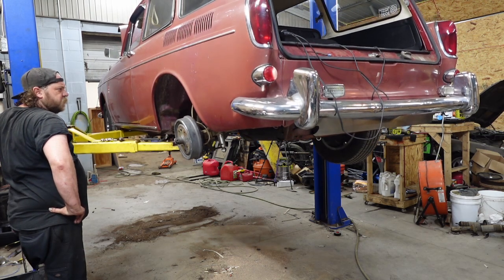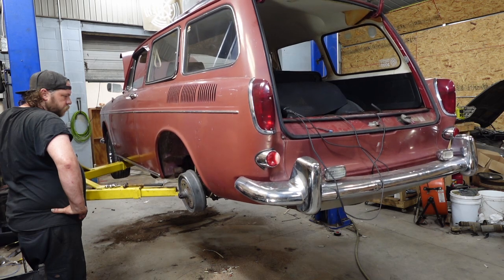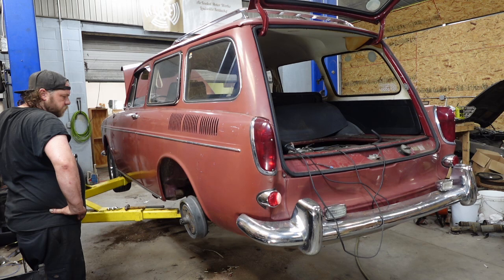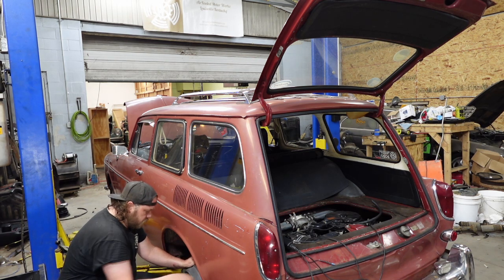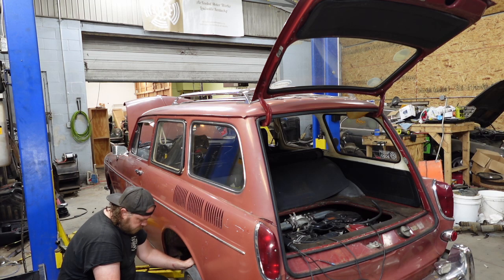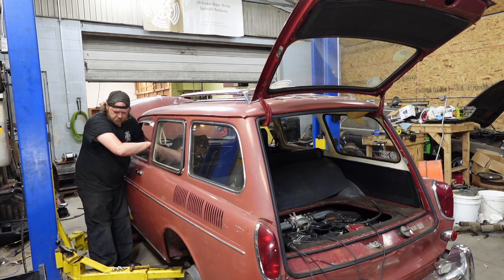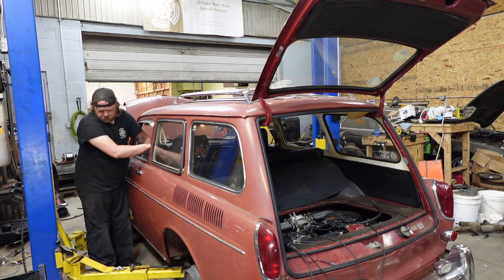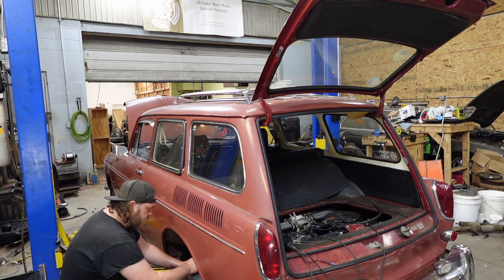And if I have to replace the wheel cylinder, I'm not opposed to that. It's just, well, I showed it. It's fine. I mean, it's bubbling. All right. What if I give you some help? Seems like that's all it needed. Okay, it probably had an air block in it to where the bleeder couldn't push enough.